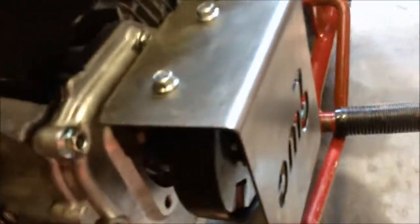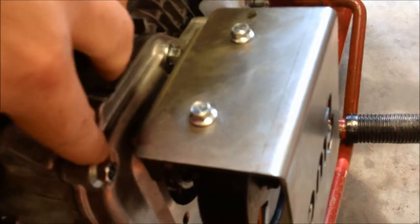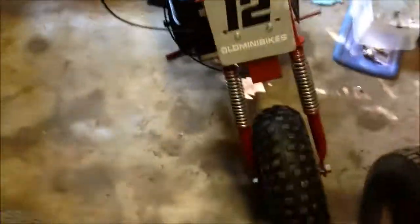I actually got the band brake for this right now, but I don't have the bolt needed to run it out and hook it to the band brake. And this clutch cover isn't made for that. If I had paid the $1.25 in the first place, I could have got the right bracket that would let the band brake go underneath it, but this one has nowhere near the clearance it needs under there to fit it.